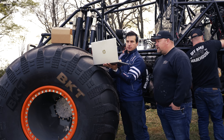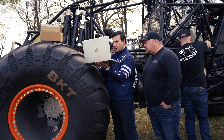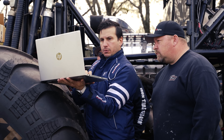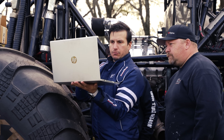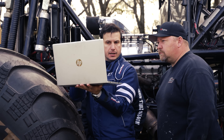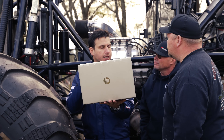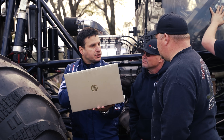So it's not 90. Here it went down to 61. It's just as bad. So with that, we can do the math — for example, we can take the chart and see how big these injectors were with 73. Take a look with the same pressure, the 520s, how big they are and do a math configuration. We're going to figure out that probably the difference is going to be around 30%. You can grab the map, take 30% off.